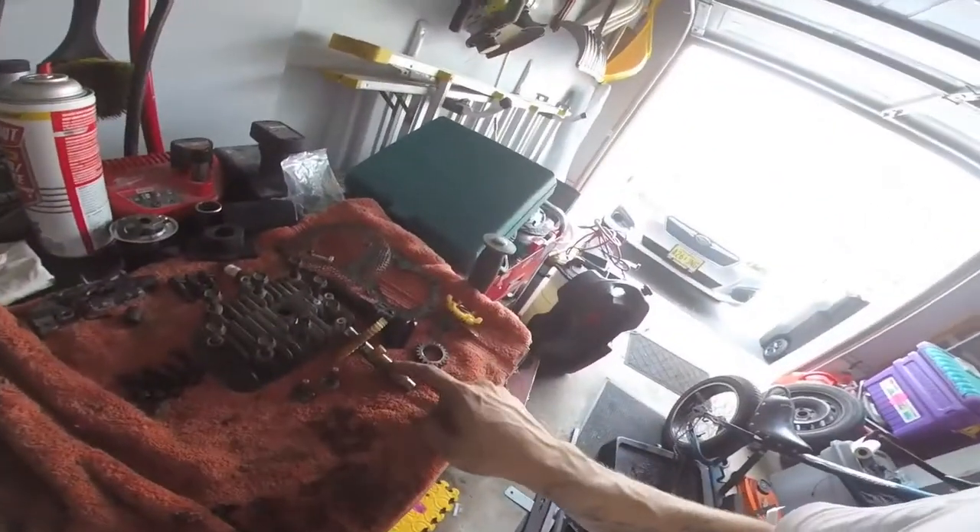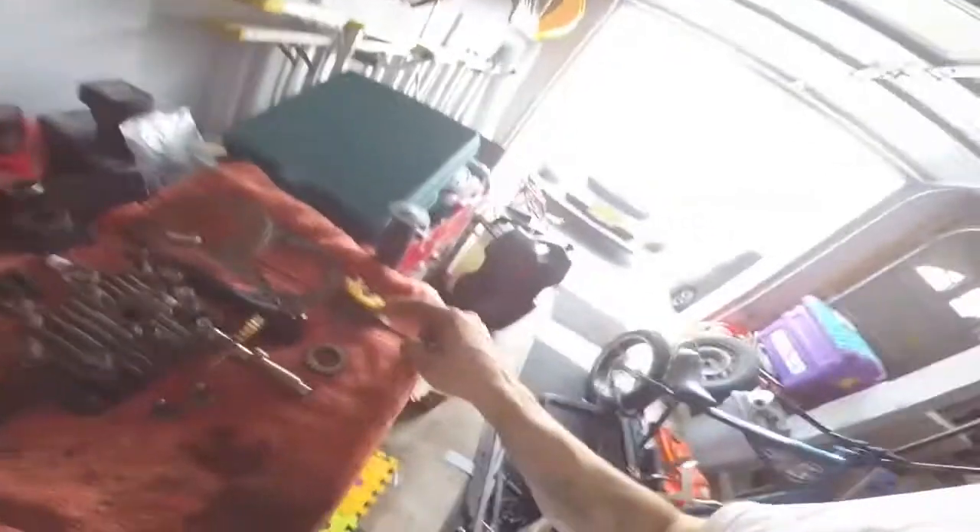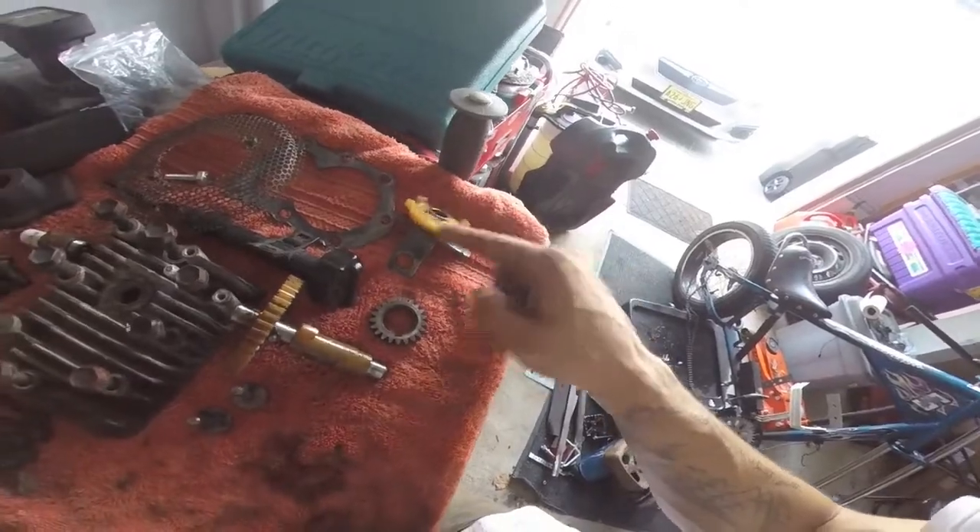It was seizing up and no one in the forums helped me, so I ended up having to cut this down and trim it — probably going to cut it off completely. Got the cam gear out with the push rods. Got the crank pulley. This is the governor, which I'm going to replace.